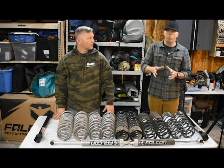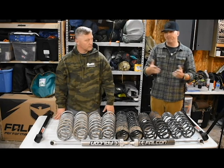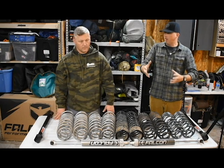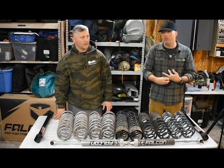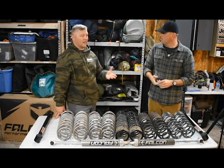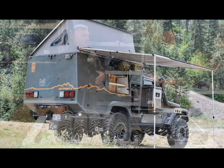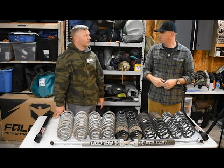But it still wasn't what everybody was talking about — the heavy duty spring. We were at Easter Jeep Safari and we probably spent two hours talking to the owner of AEV about how they designed their rigs. All he kept talking about was his heavy duty coil. We actually got to ride around in one of their four-doors that had it. They only had a four inch heavy duty coil — that's the lowest height they make. What caught our eye was a Jeep JK converted into an RV that wasn't sagging at all — it had the four inch heavy duty coils.